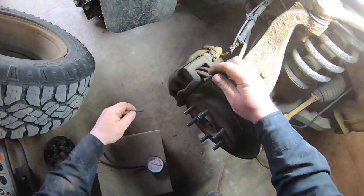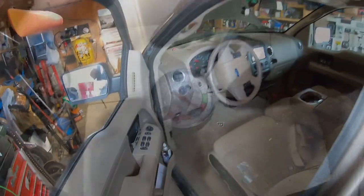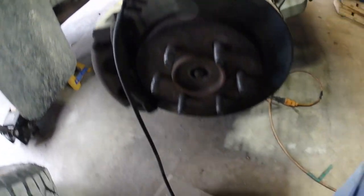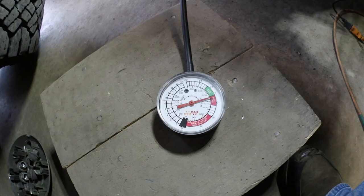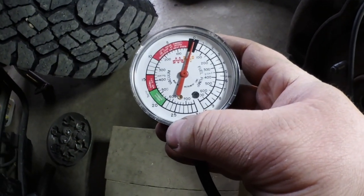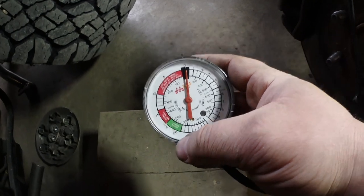I'm just going to plug that in. Plug that one in. So you can see right there at the hub, I am reading vacuum. Now, if I switch it to four-wheel drive, that vacuum should drop off. So there we go. We know right there, the vacuum switch is operating as it should. However,